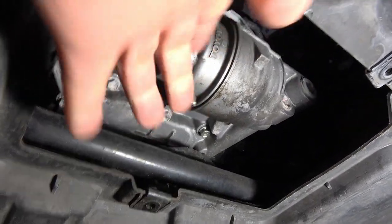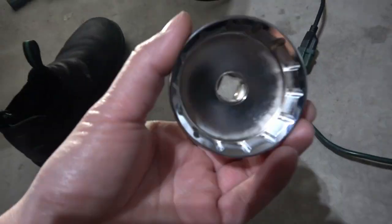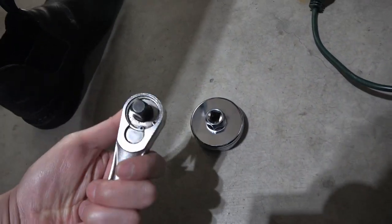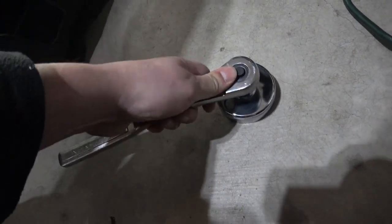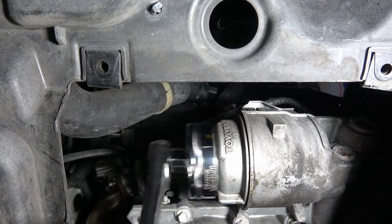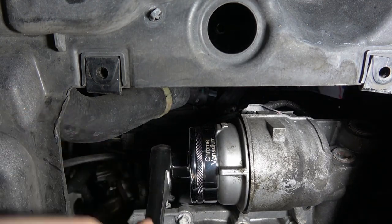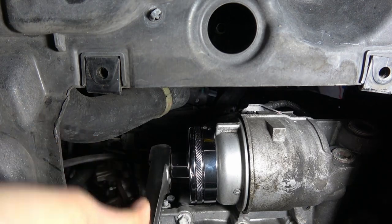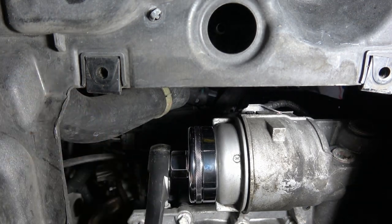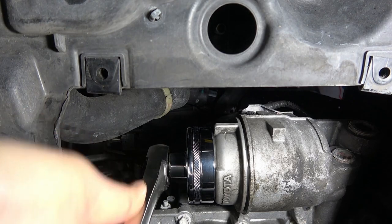We've got our little trusty Snap-on right here. Let's bring these forward. Now you guys can see that is the oil filter cap — that's where you need that specialty wrench. We'll go ahead and twist that off. We've got our adapter and as you guys can see it's just a half-inch on the back, so I'm just going to put a half-inch socket wrench on here and get this loose enough to get the filter out.